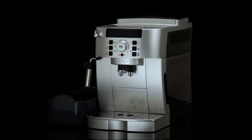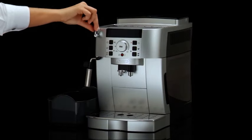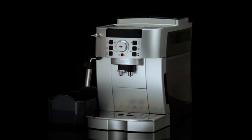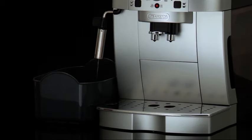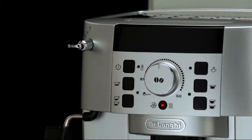The light in the button will remain on to indicate that the descaling program has begun. The steam light will flash, telling you to turn the steam dial to the I position — a half turn counterclockwise. The descaler solution flows out of the cappuccino frother into the underlying container. The descale program automatically performs a series of rinses and pauses to remove lime scale. It is normal for several minutes of inactivity to elapse between rinses. After approximately 30 minutes, the water tank will be empty and the water tank and steam lights will flash.